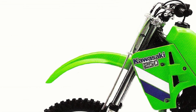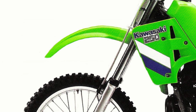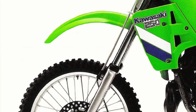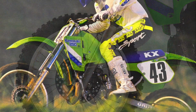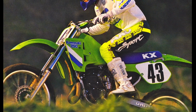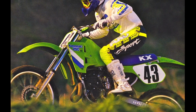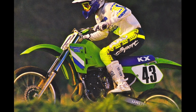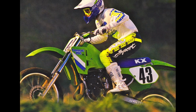While the KX's engine performance was praised by most, the same could not be said of its 43mm Kayaba forks. In stock condition, they were harsh in action and prone to damping spikes in the midstroke, as the conventional dampers struggled to flow oil fast enough to avoid a momentary hydraulic lock. This was where the new cartridge forks excelled, and the old-style forks of the Kawasaki and Yamaha really suffered by comparison. The KX's forks were not as woefully bad as the ones found on the Yamaha, which appeared to have been set up for the moon, but they were not even remotely in the same class as the excellent units found on the Honda and Suzuki.